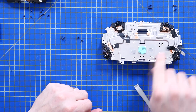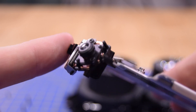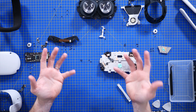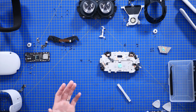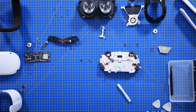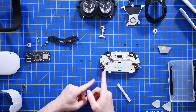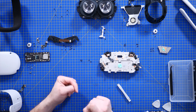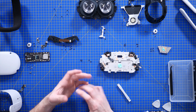You're left with the heat spreader and four cameras. These cameras are going to have super wide lenses, because their field of view overlaps with each other. The hand tracking in 3D is so accurate — even individual finger positions — so it has to be stereoscopic machine vision, like 3D vision. You can only do that if you have two cameras seeing the same object at the same time, unless you're going the route of radar, lidar, or ultrasound. The camera hardware doesn't look any different from a Raspberry Pi high quality camera. I'm also suspicious they are infrared cameras, because you only ever see through them in black and white — a pseudo-monochrome image — which could mean they're seeing mostly in the infrared range.